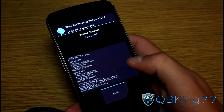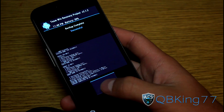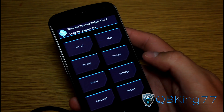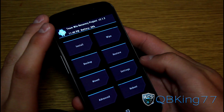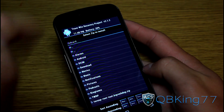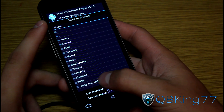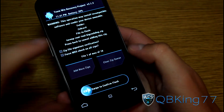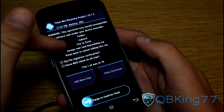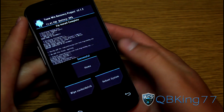The backup is now complete and successful — that's referred to as a Nandroid backup. Hit the back arrow in the bottom right corner. We are ready to root now. Press the Install button and find the Toro SP Root Tool Big Rush Dog zip file we transferred to our phone. It can be a bit finicky so keep pressing it until it selects. Make sure it says 'File to flash: toro-sp-root-tool-big-rush-dog.zip,' then swipe to flash it. It won't take long at all — and as you can see, it says 'Successful.'